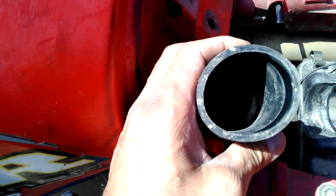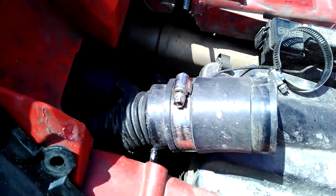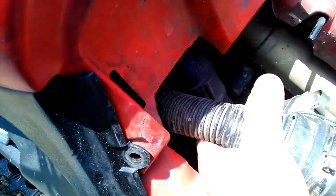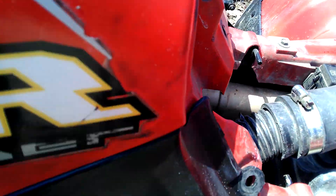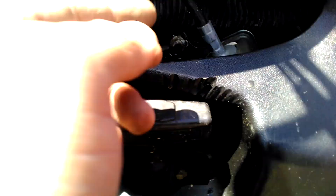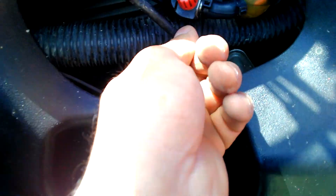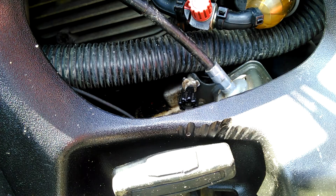As you can see, it's a very small hose — maybe one inch interior diameter. I ran it under the fender; it goes under the tank and follows the side of the engine. I usually have a zip tie here to keep it away from the engine and keep the hose from melting. Cooler air means more power, as we all know.